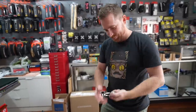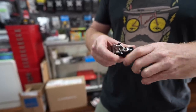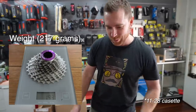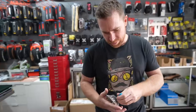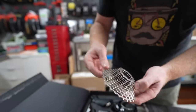The front derailleur looks like a really cheap, simple design with absolutely no over-engineering, but who knows — maybe it works better than all the over-engineered stuff. It's a simple four-joint, one-action front derailleur, all aluminium. Testing with a magnet: steel bolts, steel everywhere, then aluminium body. The cassette actually looks really good quality — possibly laser-cut — and it's light. I'm quite surprised.